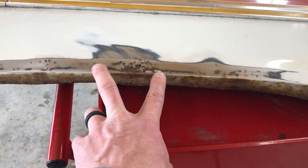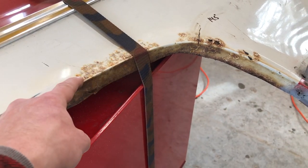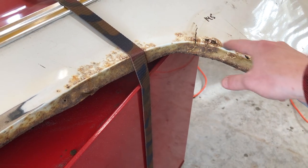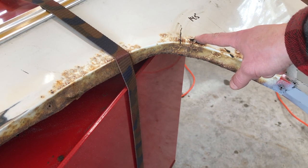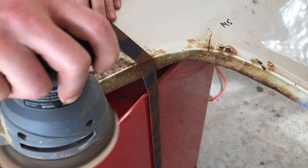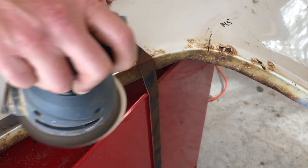Luckily, this patch isn't going to be that big and it's on a straight line. I'd be willing to wager that all of this bubbling also needs to be cut out. And the part that really sucks is this body line here — I can already tell that this needs to be cut out, unfortunately. With most bodywork, once you start dealing with rust and you start sanding away the surface rust, you end up really opening a can of worms. But the only way to get rid of this and make sure it doesn't come back is to fix it correctly.